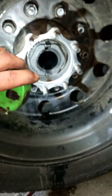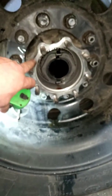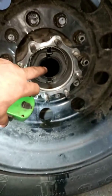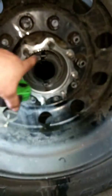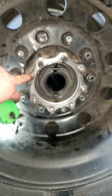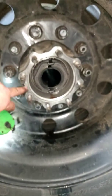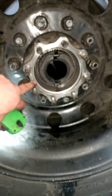Same thing on this side — clean all this with a razor blade if need be and a wire brush, spray the inside with brake cleaner, inside and out. You want to clean all this very thoroughly; it's basically prepped. Once again, if you don't and you put that new seal on there, you're probably going to get a leak. If it's black here you want to see metal, not black — that black is the old gasket, so you want to get that 100 percent off.